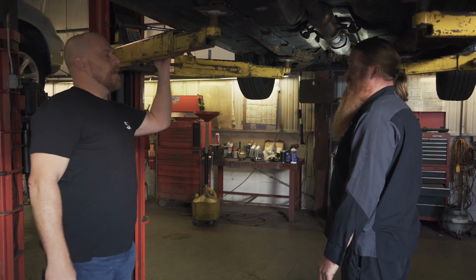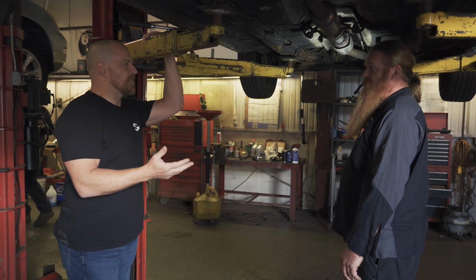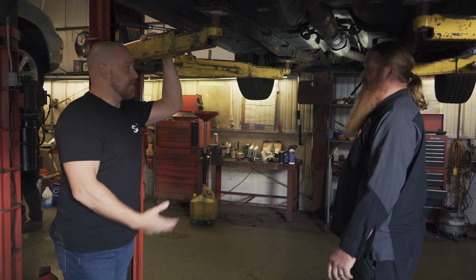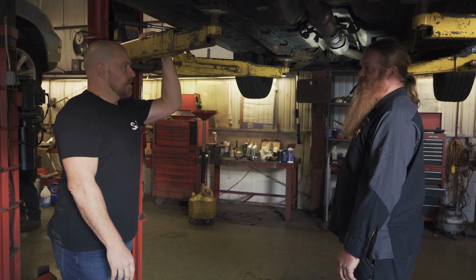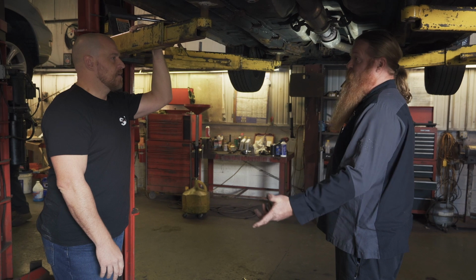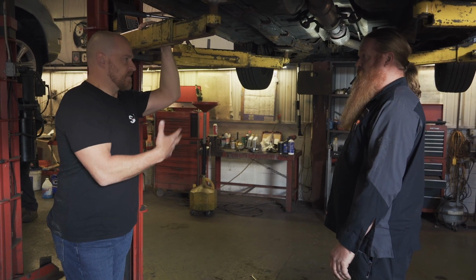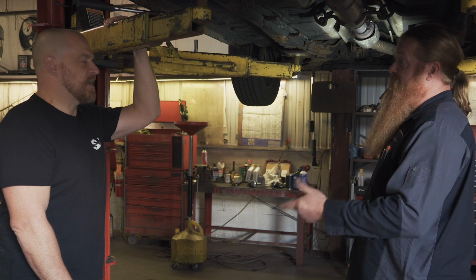Okay, yeah, I can't do that this week. But he did say that he was about 1/4 gallon low on coolant. He thinks he has a coolant leak too. So maybe we just got an air pocket in the system. He said once he had the AC charged is when he noticed it, because then it can't cool down. If that motor isn't switching on the driver's side, he didn't notice the cooling part's fine. It's the heat. But he didn't notice that until he had the AC charged.